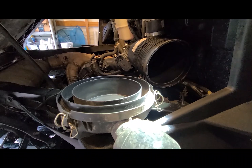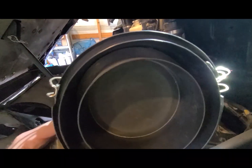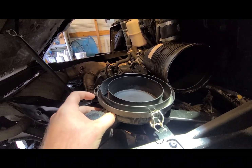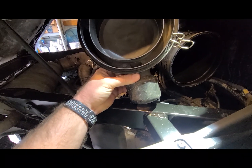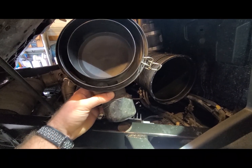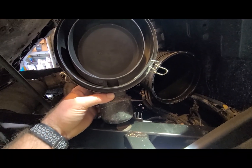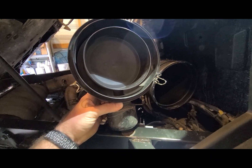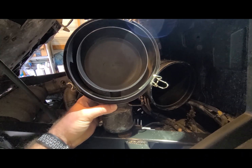I assisted a client the other day with this seal on the lid. There's a small, tiny rinky-dink gasket that goes around the outer edge, and what we did is we packed it full of polyurea grease to help seal it because it was leaking. Also, at the snorkel there's typically a duck bill, so I took a PVC cap and sealed that off so water can't come in through the duck bill. I'm going to clean this up a bit, put the filter back in, and smoke check it to see if I have any leaks at the seal. If I do, I'll put grease in here rather than replace the seal — it's convenient, it works, and it's serviceable if you need to take the cap off, rather than using RTV or silicone.